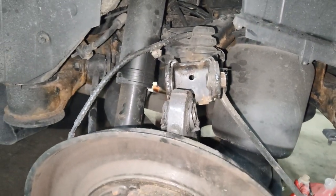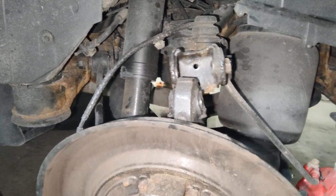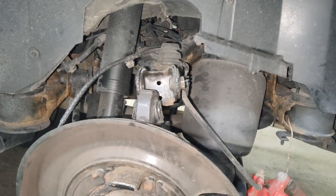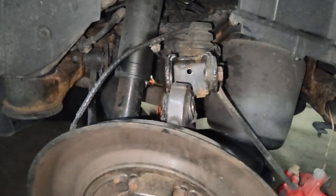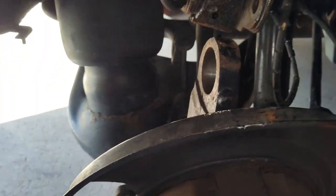Your top ones are the trouble ones — those you do want to replace. I would replace them both if you can, the bottom and the upper. At this point we can go ahead and push our bushings out and in by using a ball joint press.